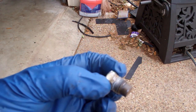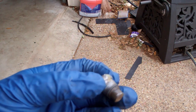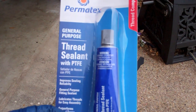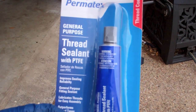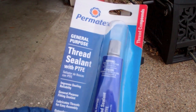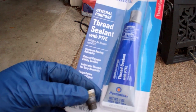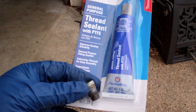I'm going to see if I have a die that'll recut those threads a little better. This is what you need to put on the threads, both on the block drain bolts and the bleeder — whatever you want to call it, the bleeder bolt. Basically you put this on the threads, and then it says up to 24 hours you can adjust it without ruining the seal. After 24 hours you'd have to start over.